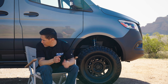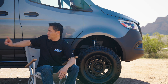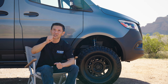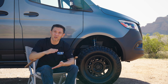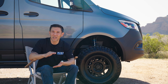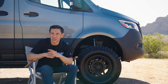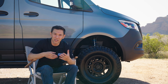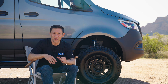For the rear, it's the same concept — get the vehicle off the ground. There's a preload coil nut on top; loosen the pinch bolt and turn the coil nut clockwise to add more preload and get more ride height, or counterclockwise to remove preload and sit lower. There is a maximum amount of preload you shouldn't exceed — typically two inches of spring preload. If you have questions, you can call either King or Van Up and we can guide you through it.